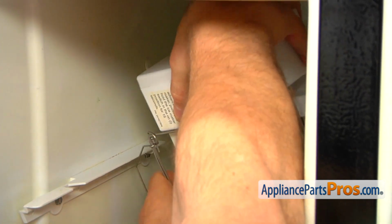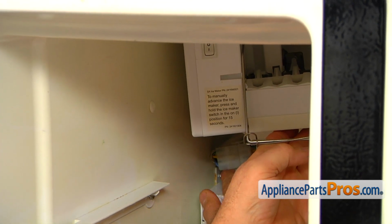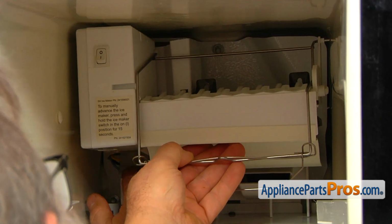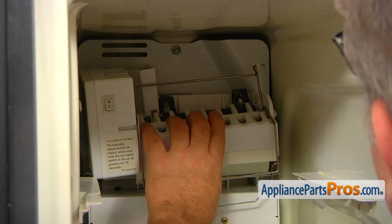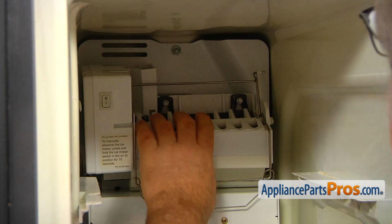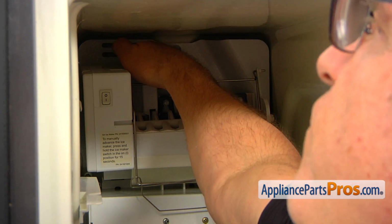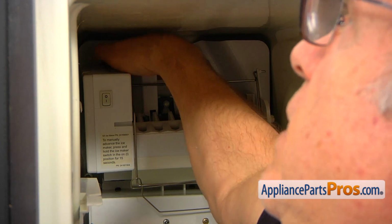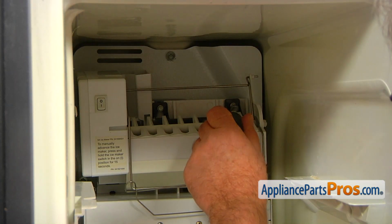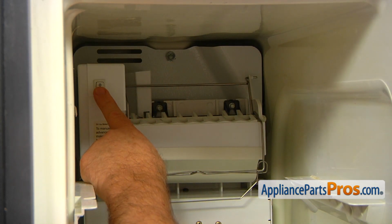And then I'm going to lift up the ice maker. Now we need to put this plug out of the way. It'll go inside the box on the back. Hang this ice maker on the 2 screws. And now before we tighten the screws, make sure that the fill tube is inside the water container here. Now we can tighten the screws. And use a 1/4-inch nut driver and tighten both screws. Turn on the ice maker.